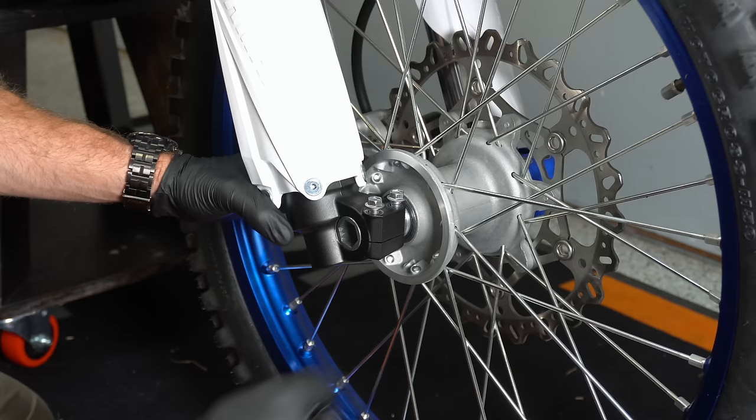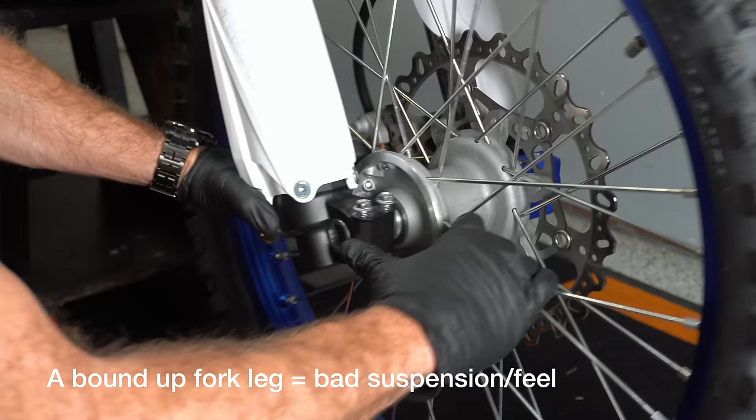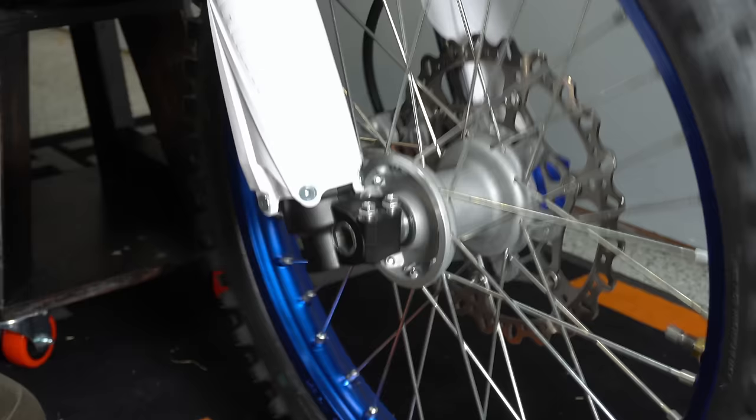It's incredibly important to make sure that this fork is not on a bind down on this axle. I've got everything loose so you can see this moving and floating. I'm going to push this over so it's actually bound up, and watch what happens when I spin the tire and then stop the wheel really quick with the brake. It actually pops right over into the place where it's naturally flush up and down.